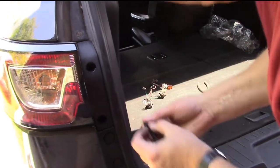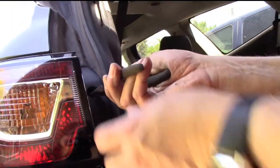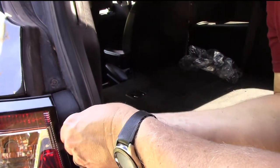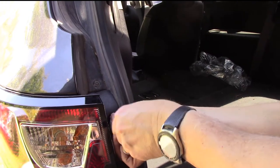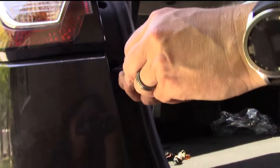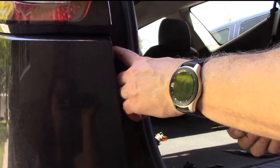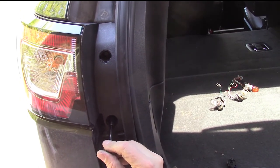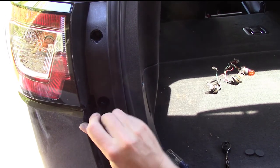Do this step in reverse. Do not lose your screw down in there — it will fall down into the body cavity above the car. Get it started, get your wrench on there, and get that baby turning. You don't want to lose it. The plastic doesn't capture it very well; there are gaps and it'll go right down into the body cavity. You just have to angle it so that it gets captured in the hole.